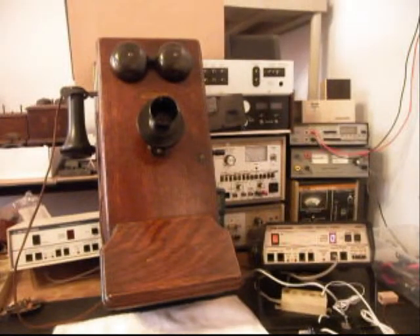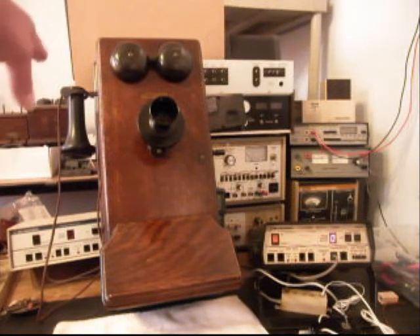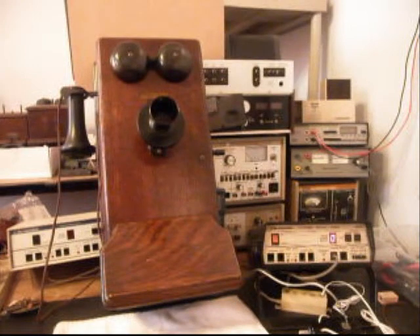We're back now and we are finished up with the repair and conversion of this telephone. We went ahead and replaced the handset cloth cord with a cloth cord. We went through the receiver, which is original to the telephone, and it is working. We replaced the transmitter with an amplified transmitter that we design and build here at the shop. So Richard will not have to be right up on this telephone talking into the spit cup — he can stand back away from it and this transmitter is sensitive enough that we'll have no problem picking up his voice for a quality conversation.